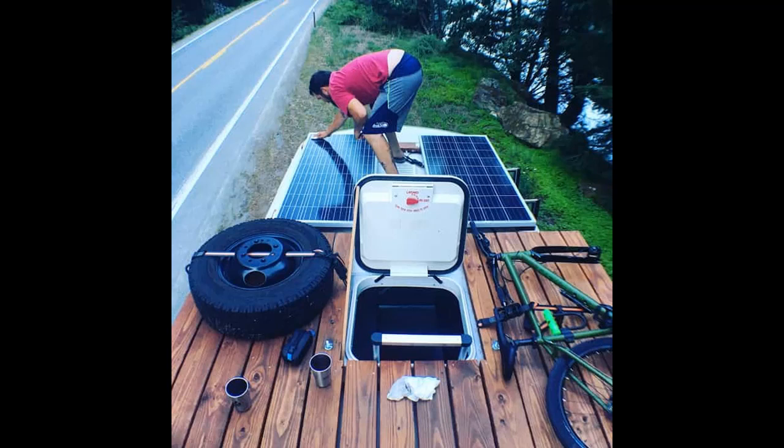Mistake 5: Adding Too Much Weight to the Bus. It's easy to get carried away with conversion plans and not take into consideration how much everything will weigh. To keep your vehicle weight in check, I recommend starting by getting your bus weighed after you strip everything out so you have a baseline, and checking the axle and tire weight ratings on your vehicle. When designing your layout, keep in mind that you want to have a balanced load — don't put all your water tanks on one side without having something equally heavy on the other side. Also don't forget that the weight of your water tanks will vary with the fullness of the tank. We saw a couple on Instagram who installed something like 250 gallons of fresh water storage at the very back end of the bus underneath their bed. One gallon of water weighs about 8 pounds, so that's around 2,000 pounds of water cantilevered out behind the rear axle.